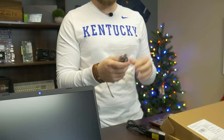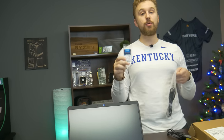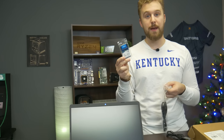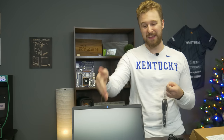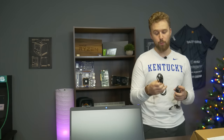We're gonna go ahead and power this on, make sure everything's working properly, and then upgrade it with four more gigs of RAM since it only comes with four. One important thing to mention: with Vega APUs, they use onboard memory as VRAM. So the graphics card defaults to using about one gig of system RAM as VRAM, meaning this thing right now effectively only has around three gigs of usable RAM — which is pretty bad by 2019-2020 standards.